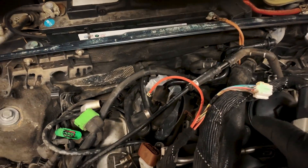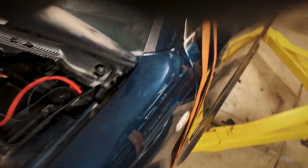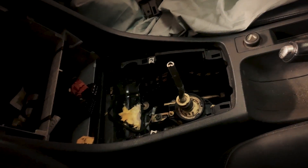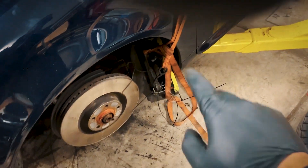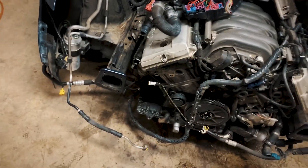Except the heater lines and the slave cylinder — everything inside is already out. One difference on the B6 between the B5s is that you have to pull off the whole stereo to be able to get to the shifter bolts. Like I said, it's all done. I'm practically ready. I lost my hooks so I'm kind of ghetto-rigging my calipers right now, so bear with me.